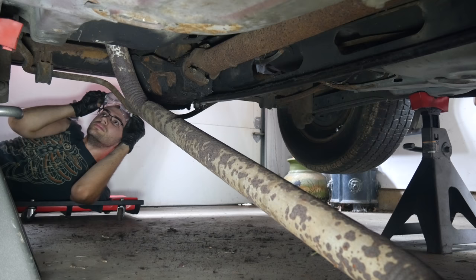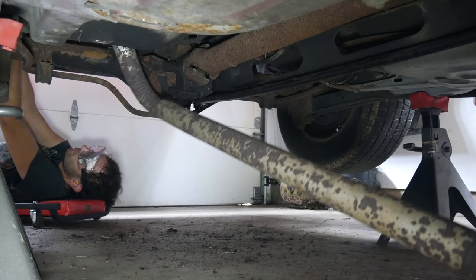The trick now is that we have to get the exhaust pipe over the rear axle. If the car was on a lift this wouldn't be that big of a deal, but since the exhaust is pressed against the floor this presents some challenges. To get a little bit more wiggle room we ended up unbolting this brace that goes down to the track bar bracket.